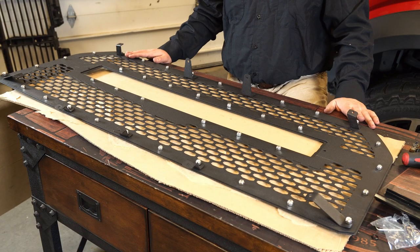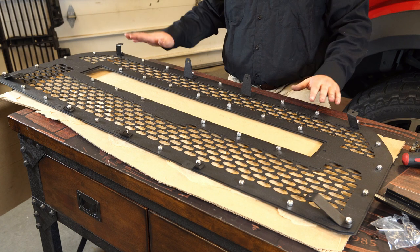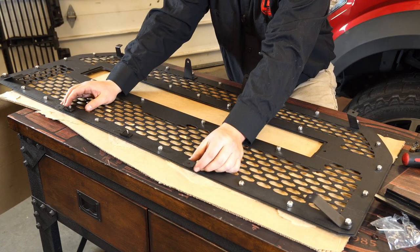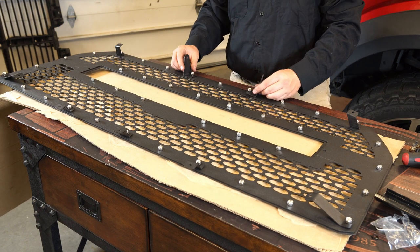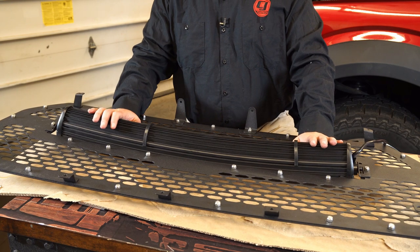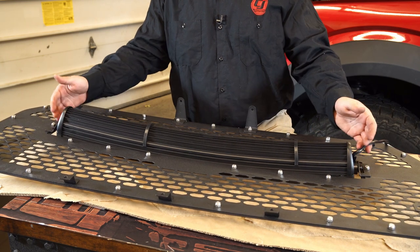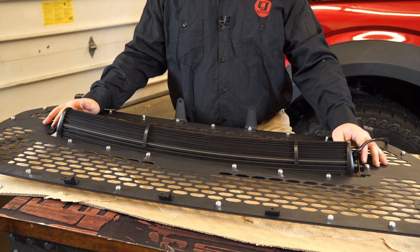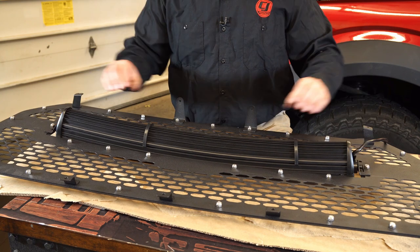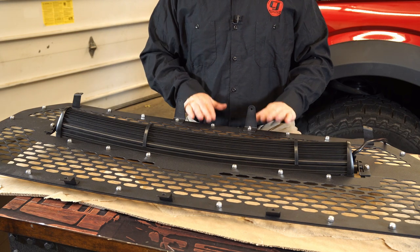This is the orientation and location of all the brackets you'll need, besides the light bar bracket. This is the top of the grille and this is the bottom — you can even pause the video right here. These two angle towards the inside, and the brackets down here actually go a little bit outside of the grille, and these ones go towards the bottom. Now that we have them all in the right location, we'll use our same tools to get these tightened up. If you are installing a light bar, these are the two brackets you'll need. The hardware for the light bar is going to be in the box in a small separate box that uses universal mounts. Grab the black allen key bolt, tighten that down all the way, then use the standard allen keys to tighten down the sides. That does give it a nice curve once you install the light bar — you can see it's going to match the contour of the grille.